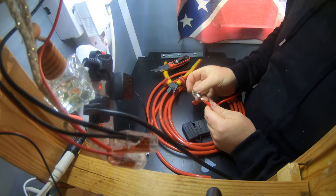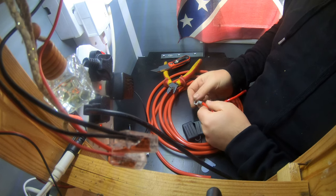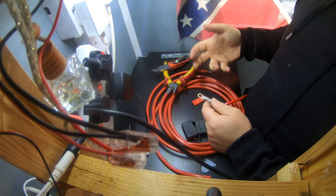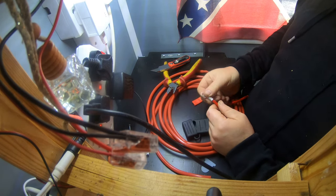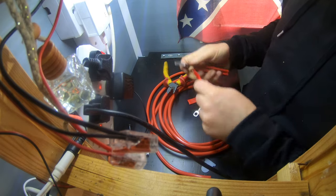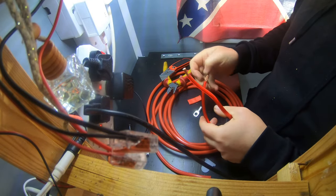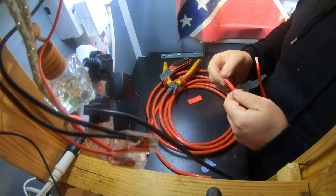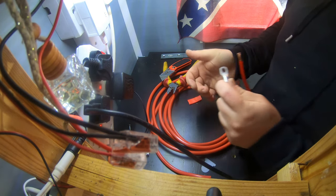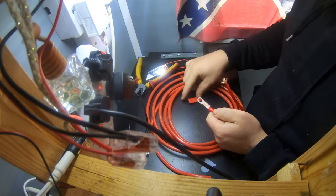So that is going to sit in there like so. You can fill these with solder, or you can crimp them down with a crimp tool, or you can hammer them, or you can mush them in with a pair of pipe grips. As long as it holds and it ain't going to come off, then I wouldn't worry too much. Same with this side. Bosh. Right, now obviously I haven't got a crimping tool at home, so I'm going to whack it with a hammer. Now, they don't look amazing when they've been hammered, but oh, that ain't coming off of there.